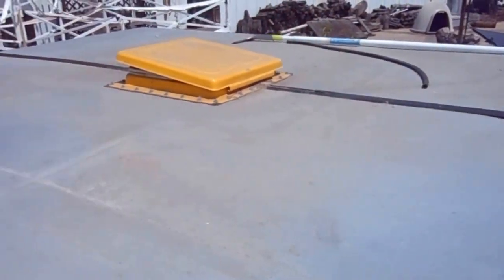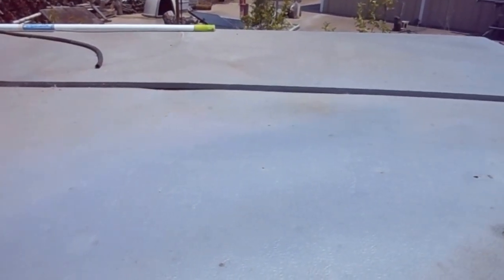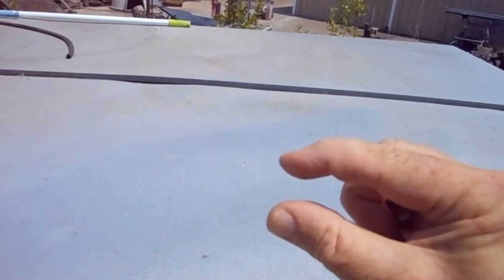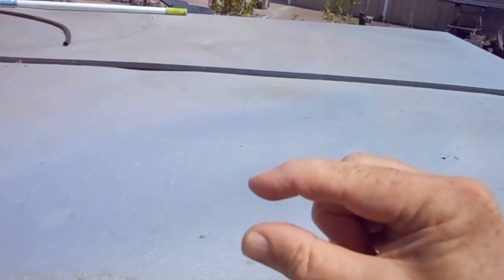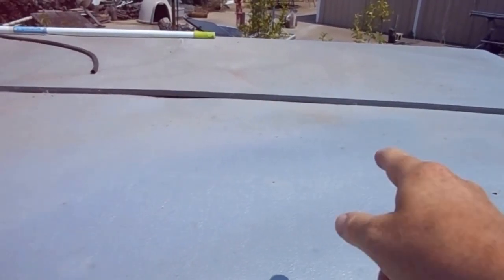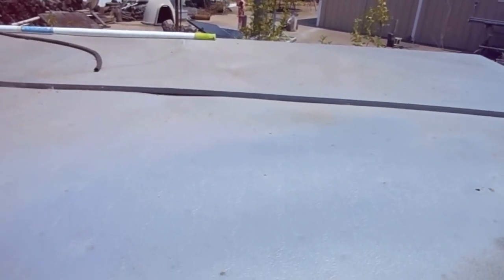You've got 88 square feet of roof and it's not designed to support itself, which wouldn't be so bad if the skin didn't bubble up. It'll get so hot it'll make like a balloon — it'll separate this far away from the roof itself in certain situations. Right now it's not that bad, but it's lifted itself up so much that it's broke the seam that runs down the middle of the top, so it leaks really bad.